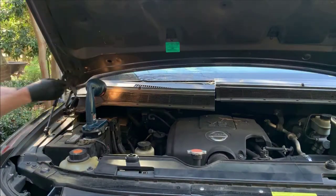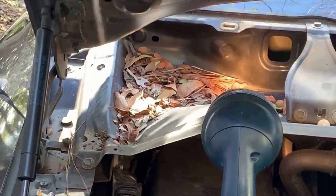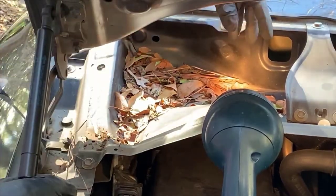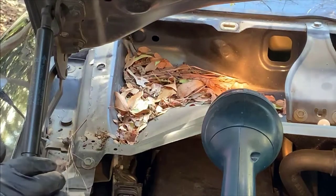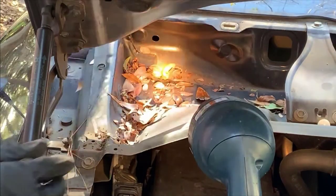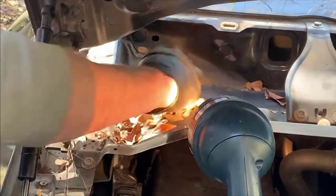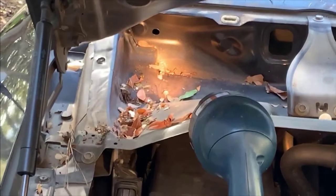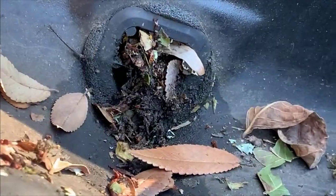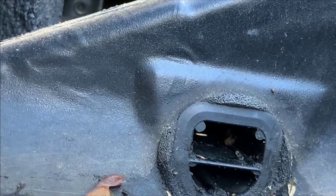Some things just take patience. Remember this stuff is old and brittle, so don't just pull without seeing exactly what you're pulling on. Here's our problem — I think this is why I was getting water inside the cabin. A lot of leaves had gathered and made their way through the cowl, so I scooped all this out. Looking closer at where the drain actually is — there's the drain. I can certainly see why water wasn't getting out very well. I pulled that clog out of there and it looked a lot better. We'll test that in just a second to make sure water can get through.